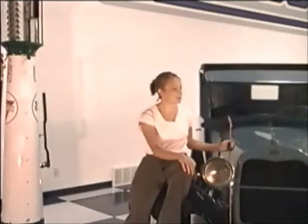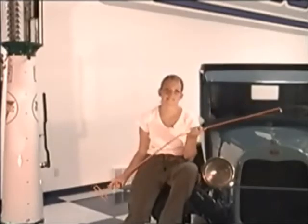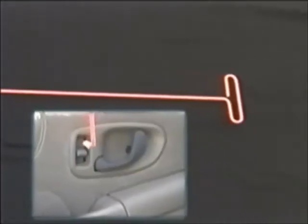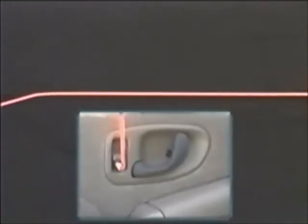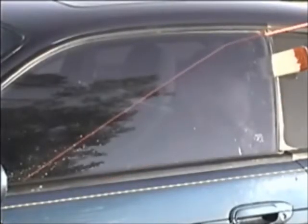The Big Easy lives up to its name not only because of its ease of use, but also because of its simple design. The tool is made from quarter-inch steel which is pliable enough to form to different angles, yet carries enough strength to give the user plenty of positive energy to manipulate a locking mechanism. It features a Teflon-based coating which prevents the tool from scratching or marring a paint surface, and its color allows the tool to be highly visible even through the darkest window tinting and at night.